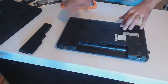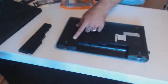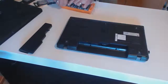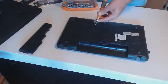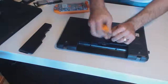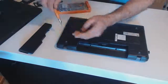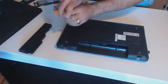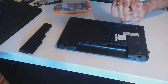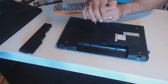On the Lenovo Z575 you'll see screws right here in the compartment, and it gives you little symbols that indicate that the memory is in this section. So you want to start opening up the case. Find your screwdriver tip that fits the tiny little screws on the top of the case and you should be good to start unscrewing. There are a lot of screws you don't need to unscrew, so just look for the ones that are actually in this component area here.